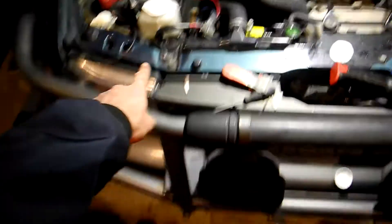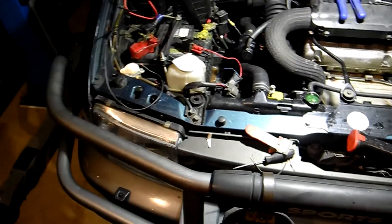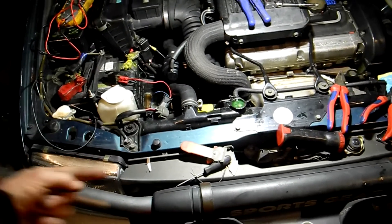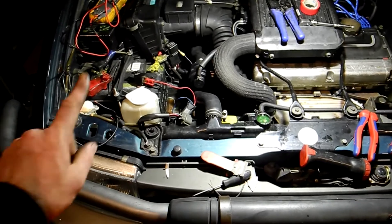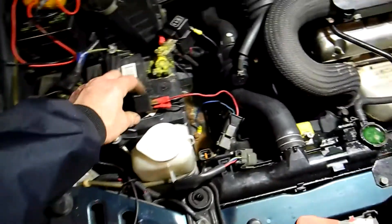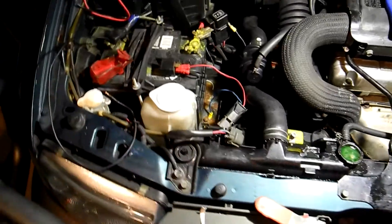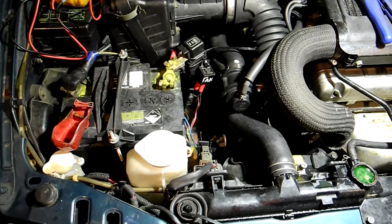So that's how you wire a ground switch relay. For your information, if you can't wire spotties or you can't wire stuff to your car, it's usually because it's ground activated — headlights are ground activated. It's because you're not pulling all the current through the relay; you're pulling it through the power supply source, and it's just a more efficient way to do it. That's why manufacturers do it, so just do it the right way. Well, this is temporary so I'll sort of put this somewhere, tie it to something temporary and sort it out later. It works. Who am I kidding — it's probably going to stay like that forever now.